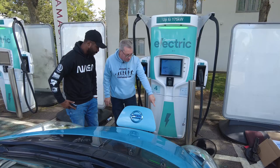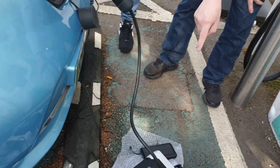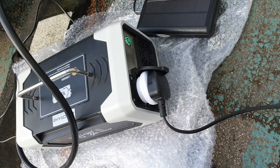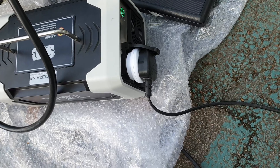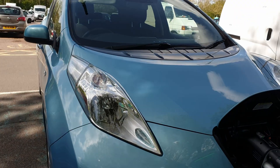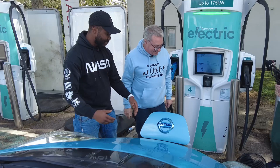On the back of this box on the floor here, what's going on is the Type 2 goes into this box, and on the back of the box there is a mains socket. You can have a UK plug or a European or American one, whichever the customer prefers. And that is powering this fan. In short, what's happening is we're getting mains power out of a 2016 Leaf.